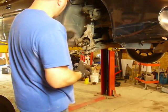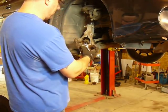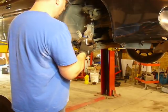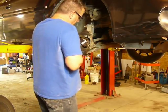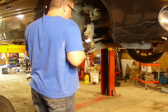Okay, remember the wire comes out here and it clips into this little guy right here. So when you put this in, you're going to want the wire fed through in that position right there. So we'll put our shim on the bearing. Use your thumb and push that axle back, and you should create enough of a gap to get that wire connector through there.